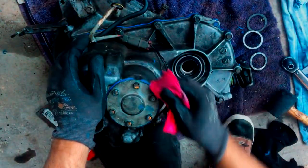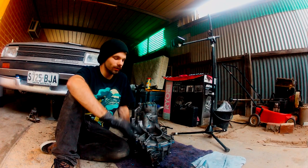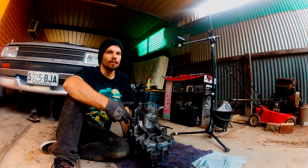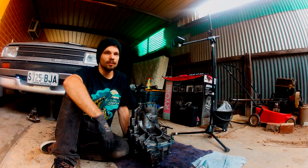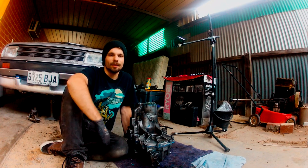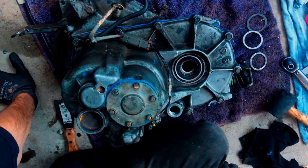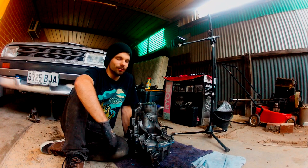There you go - there's really not much more to it than that. If you've followed this guide the whole way through, you should have now learned how to do the N13 internals conversion. It's going to result in a lot more torque down low where the N12 really needs it. You're going to have a shorter gear range, but you'll feel the power build up a lot better than the N12 gearbox, just because of the different gear ratio that we've put on there - it alters the diff ratios quite a bit, but it's definitely noticeable and in my books it's definitely a mod worth doing. Big thanks to Evan Lyons for helping with this guide - he's one of the guys who originally did the text guide on N12turbo.com. Also thanks to Anthony Sabino for the N13 gearbox; without that this guide wouldn't have happened. Hope you enjoyed this video tutorial - please like, subscribe and comment. We are going to be doing more tutorials and guides in the future.